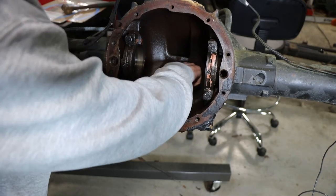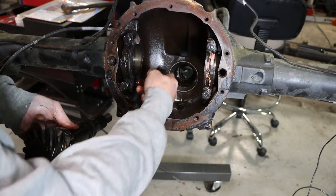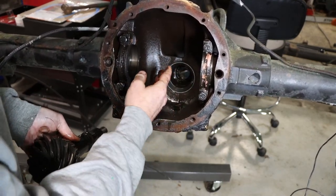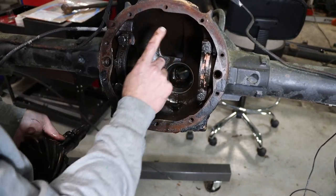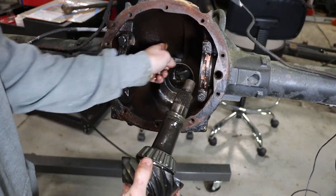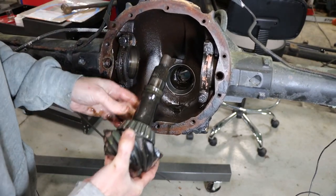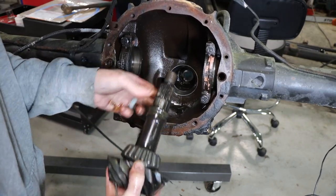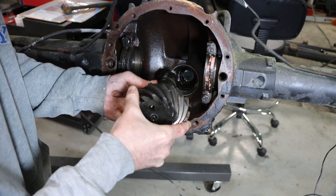Oh, wow. Check that out. A gear tooth that got picked up. Sorry for the dehumidifier. That got picked up by the ring gear slinging oil. It slung it into this galley here. That's how the bearings from the pinion get oiled. That ring gear slings it in there, and then it comes out of that bottom hole down there. And those bearings are shot where they've eaten up all that metal goo over who knows how long.